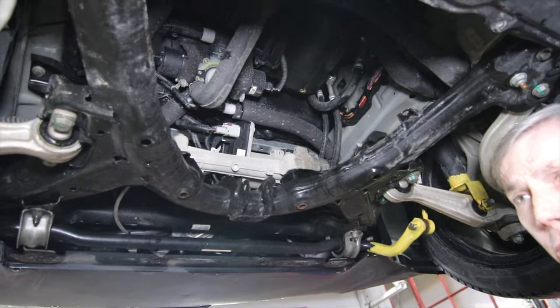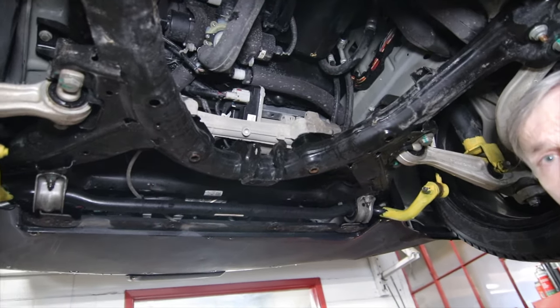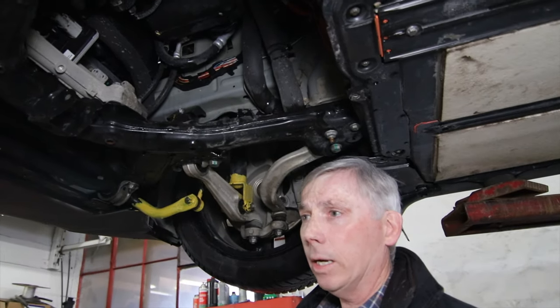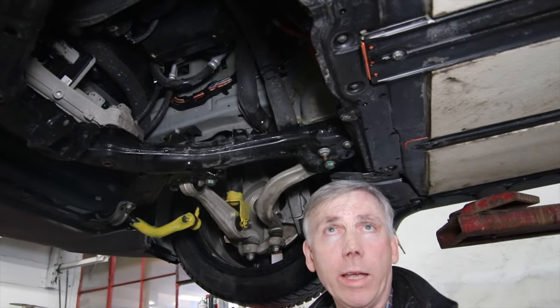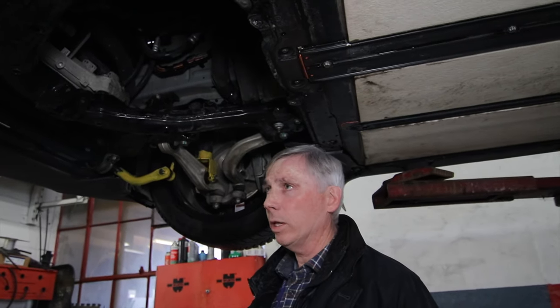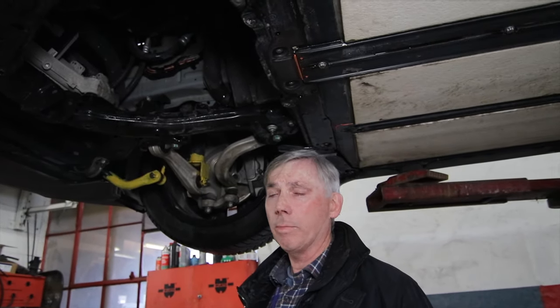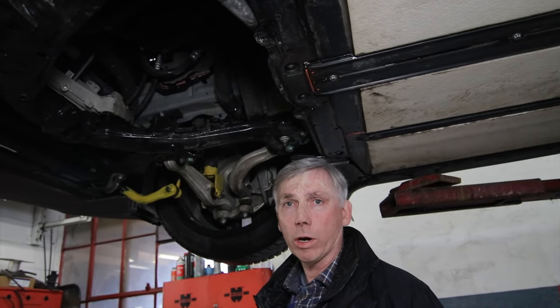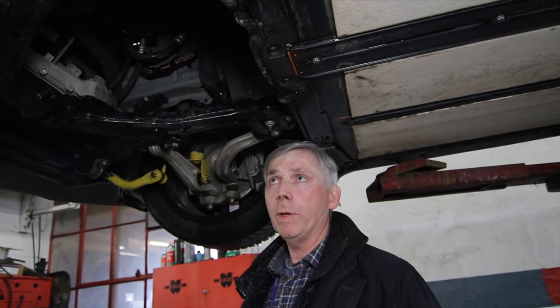Keeping warm. Yeah. We do have that heating system preheating the battery when you're warming the cabin, and that's great. But of course, you're taking energy from the battery to do that. And that system turns itself off once you start driving. So the only thing that's actually warming the battery up is just the normal resistance from the motor, which, as I mentioned before, is very, very slow. So we're just trying to speed up that process, make it a little bit easier for the car.